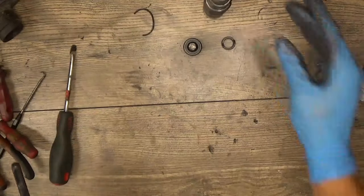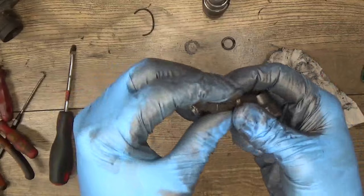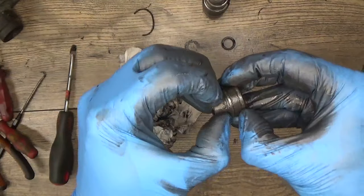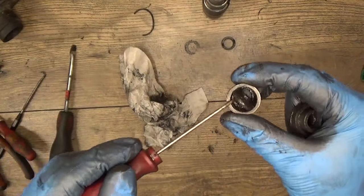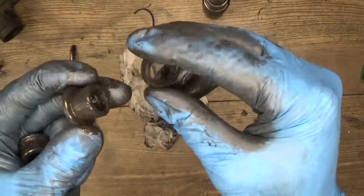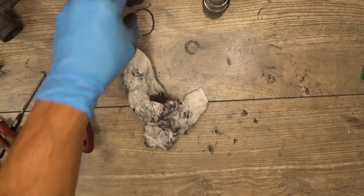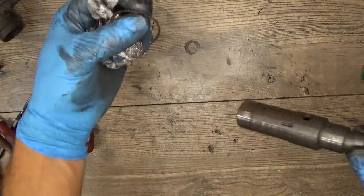I can see that the inner ring of the tool holder was cracked, so it will need to be replaced. About our drill problem — you can see that it's round inside and we cannot see the two pins. Normally the two pins go here on an SDS Plus drill and they prevent the drill bit from turning around or getting stuck in the tool holder. So of course this one needs to be replaced. The striker here has a small bump, so we can consider replacing it. The O-ring — we need to check if it's not cracked; now it's not cracked. The spring ring needs to be replaced, so we need to replace the tool holder and the spring ring.